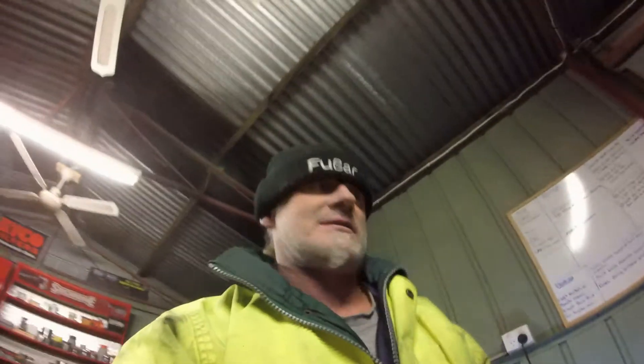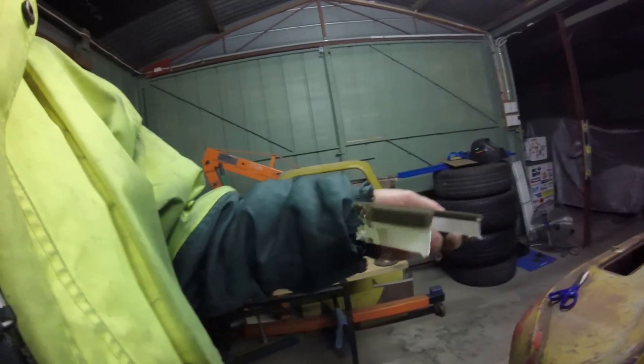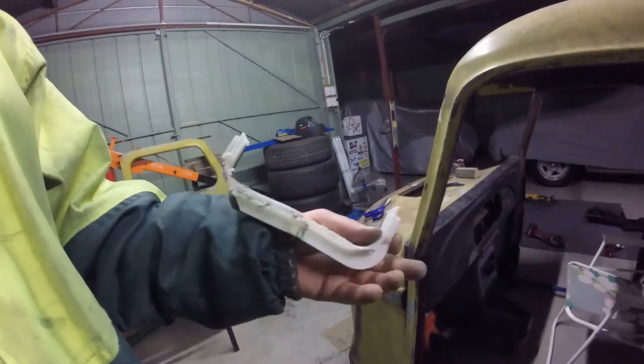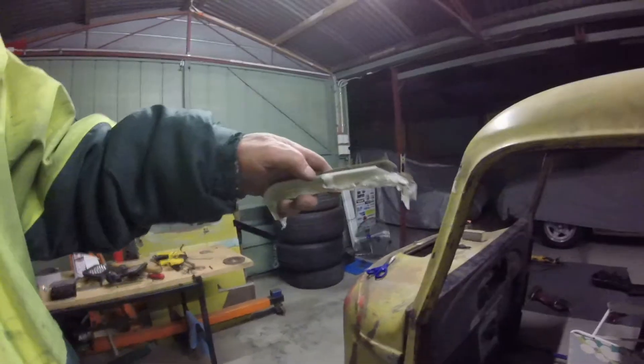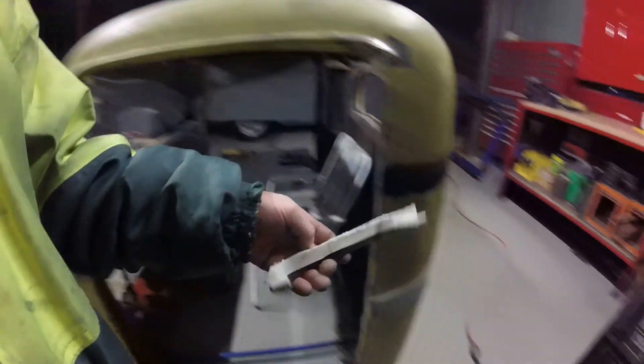I do apologize if it's a little bit dark — I'm trying to film this at night. The fan box — the little piece I took off the top was originally just a small snippet out of the corner to try and clear the cowl, as it was just brushing up against it. I decided to take a bit more off seeing I've closed that off now, so I don't get any vibration. I cut it down to the first clip that holds the body of the unit together — didn't go below that, so it's still got the clip on it.